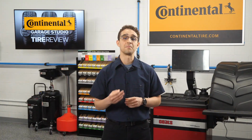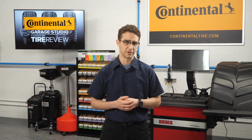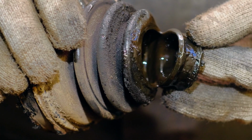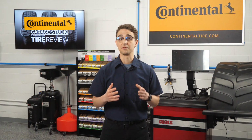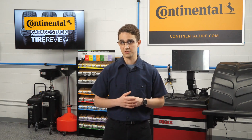A boot failure is bad news for any CV joint because it dooms the joint to premature failure. A split, cracked, loose, or torn boot will throw grease, draining the joint of its vital supply of lubricant. Sooner or later, the joint will run dry, which is not a good thing for metal-to-metal surfaces that must withstand high-pressure loads and constant friction.